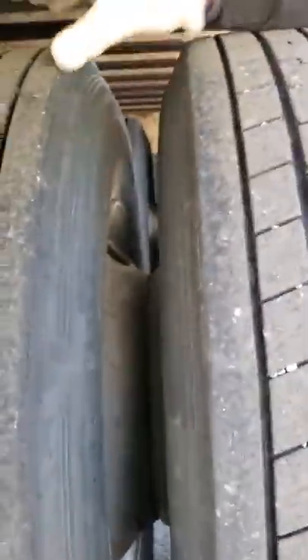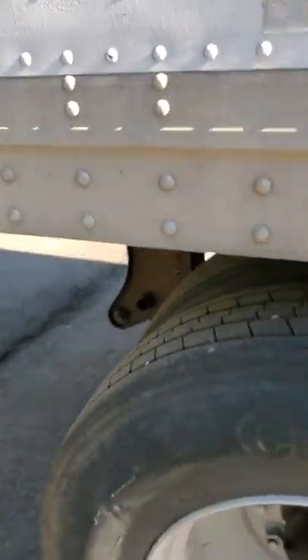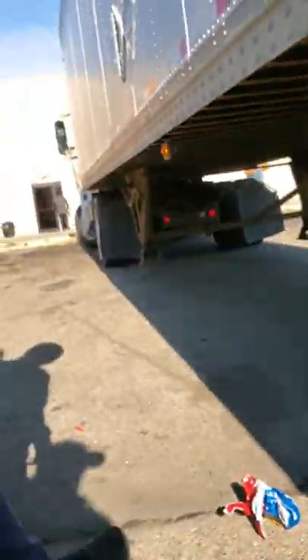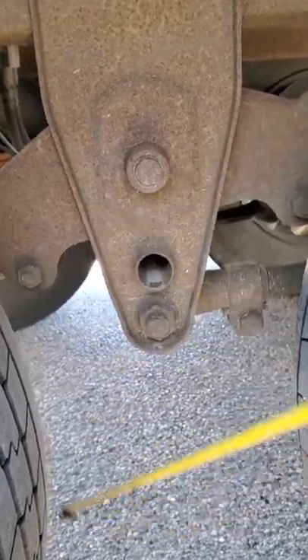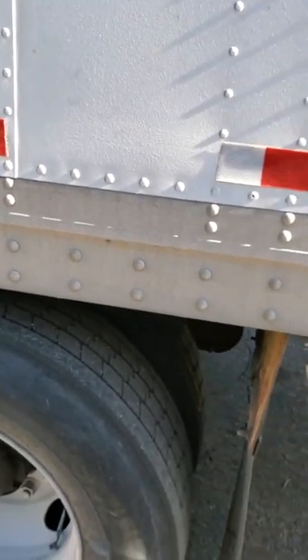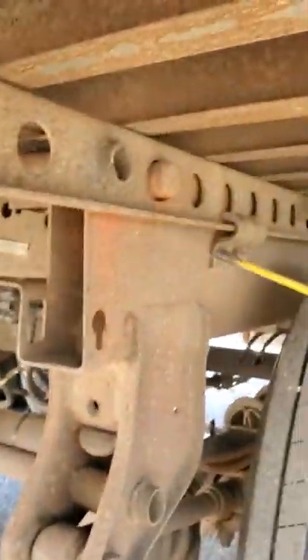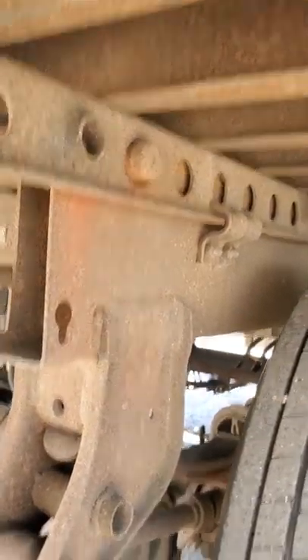This tire — inner outer, inner outer — properly spaced, no debris, evenly worn. Check these like we did on the drive axle. Rim, lug nut, valve stem — check these like we did on the steer axle. If there was an airbag — which is not on this trailer — the airbag mount and airbag would be checked like I did on the drive axle. The sliding tandem is securely mounted, not cracked — all the pins are extended through the holes and the handle is in the locked position.